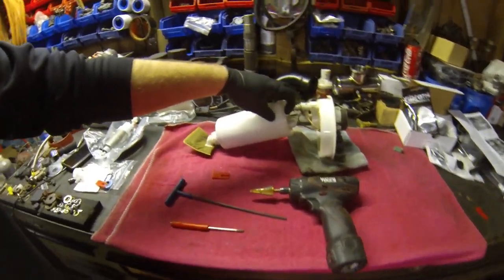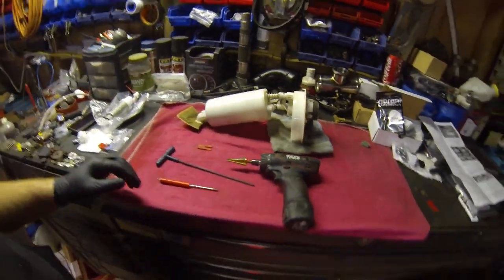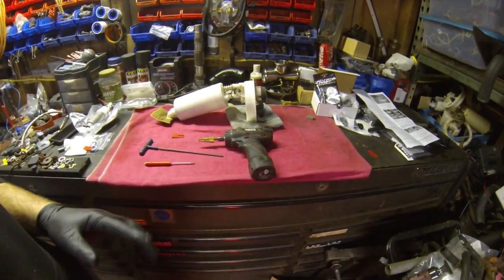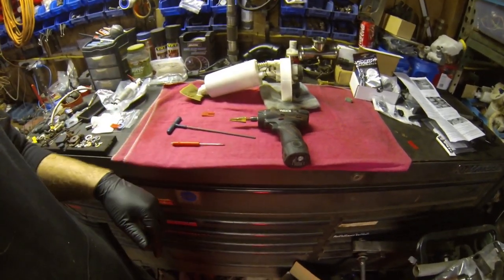The 3/4 inch hole is going to give you enough room to have that hose come through. That's a 5/8 outer diameter with the one that I'm using. So the 3/4 gives a little bit of room so you're not just sitting there vibrating against the edges all the time, wearing a hole in it. Gives it a little bit of room to breathe. But yeah, we're going to go ahead and get this guy coming apart.